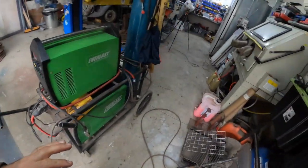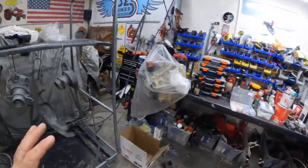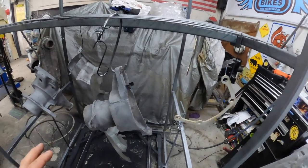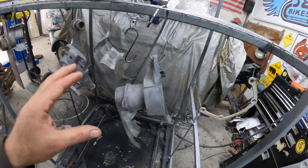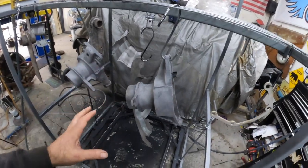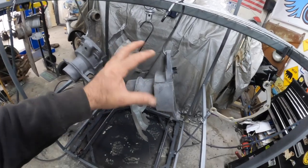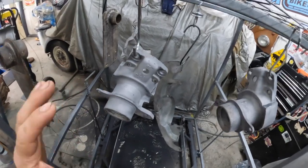With the powder, basically, yeah, 10 minutes at 200 degrees. So it's got to cure. It actually does have to get up to temperature. Normally with these components, I will put them in the oven and heat them up to 200 before I put any powder on them, and that'll just burn off any impurities on the surface of the metal so that you're getting a good clean surface.